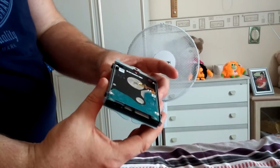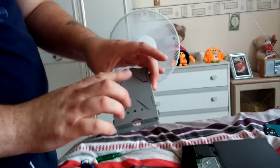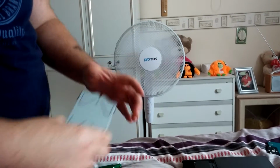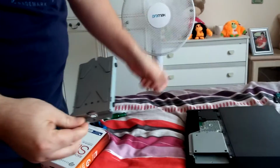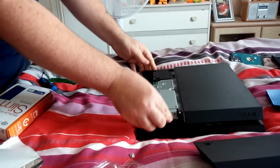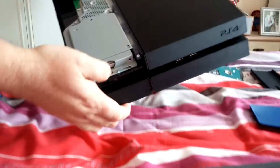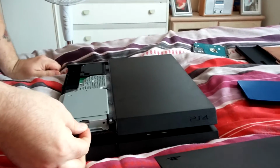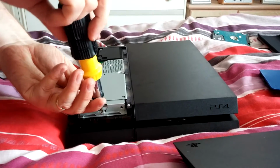This is just the PlayStation drive now. So if you've got this model, the drive bit goes down. I can't remember what it was like on the other machine. I think it's the same, but I know the screw is on the side. It's exactly the same process though, and obviously there's the software bit at the other end. So get the drive, push it into the PlayStation like that till you can hear it creak. The screw lines up in the machine. Get your PlayStation screw and the screwdriver for tightening up. Obviously, don't overtighten this.